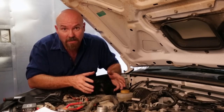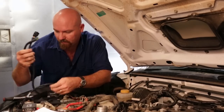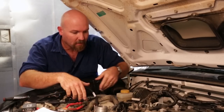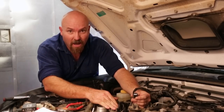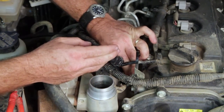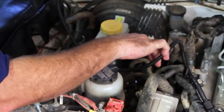Just going to show you exactly how easy it is to install. Now for the cameras we've actually removed the intercooler off here. We get a wiring harness — it's got three plugs on it. So we unplug the plug off the fuel rail, plug one down into there, plug two onto the fuel rail, and then we route the harness down through here.